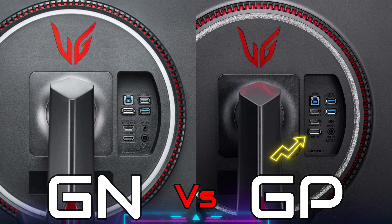So that's one way to tell, and the number one thing is the foil system on the GP backlight — you can see it's foil-looking compared to the white diffused plastic on the GN version. That's the main feature: the display port position and that foil system in the back. You don't want to be duped into buying something on eBay or used without knowing the differences, because they actually look almost the same other than the display port and that foil.